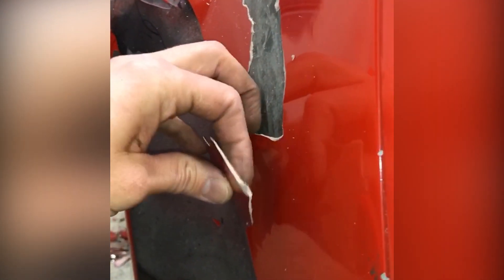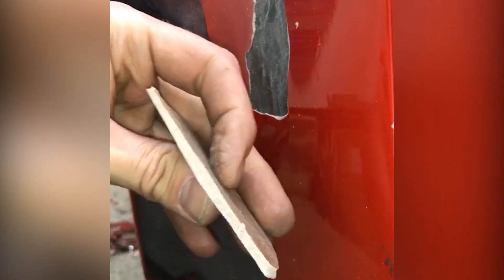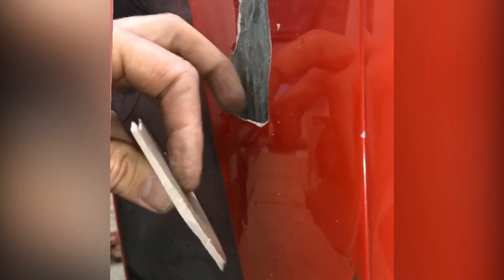For those of you who don't really know much about paint and body work: if they smooth on and cake on a lot of Bondo — which is a body filler used to get rid of bumps and do transitions — that's generally a sign of really poor bodywork. The metal should have that shape to begin with. If the metal doesn't have that shape, lazy bodywork is to smooth it out with Bondo. But to have this kind of thickness is just a sign of laziness and failure to prep the metal correctly. It all started with the hack job of the turbo flare add-on.